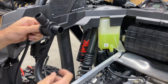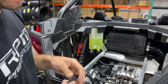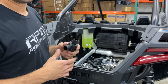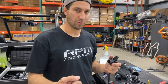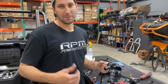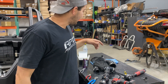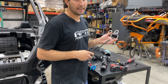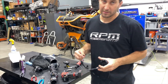There's your factory blow-off valve. The factory blow-off valve is plastic, and it sees heat over time, warps, and then can no longer seal. Ours is billet aluminum — you're not going to have those issues. There's actually a video of us holding a torch against it until the anodizing turns orange it's so hot, then we install it back on the machine and keep running it. It ain't warping, the O-rings aren't burning. You now get an extra O-ring set and O-ring grease in your kit, and they have a lifetime warranty.